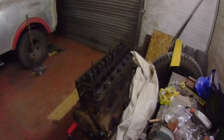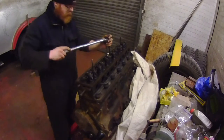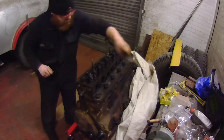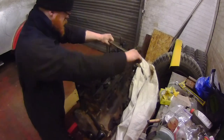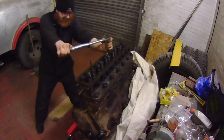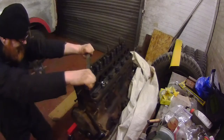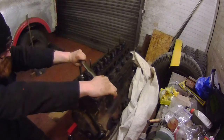Engines with 9/16 inch studs, stud nut on manifold side, and 5/8 inch stud nuts on the other side are 100 pound feet for both sizes. My torque wrench does not have pound feet, but it does have kilogram meters. 13.8. But it starts getting entertaining with my wobbly engine stand.